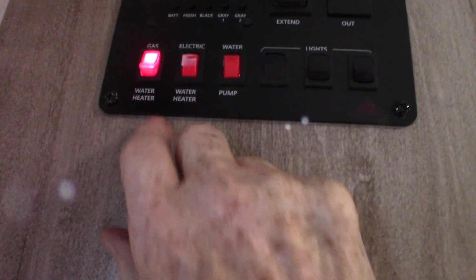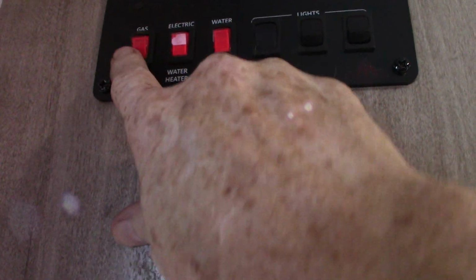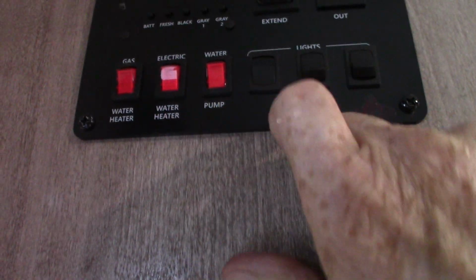So you have a Murphy bed that folds down. As you see right here, you just pull that in. You flatten out the jackknife sofa by grabbing it down there and flattening it out, and the bed folds right over it. Okay? Your control panel is up here to light your water heater on gas here. To turn on the electric heating element, it is right there. Like I said, don't run the water heater without water in the water heater tank.